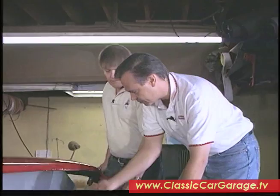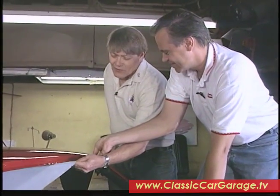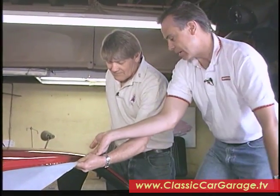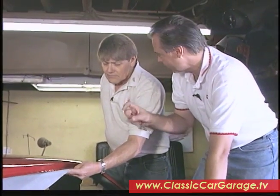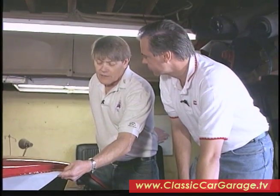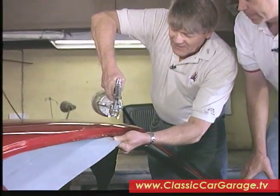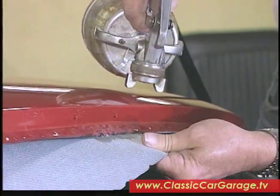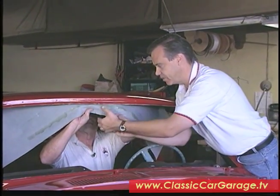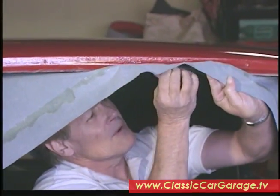Now that we've got our bows installed and the headliner's in the car, the next step is to glue the headliner up here. Your seventh grade shop teacher taught you something very important — when you're doing any gluing, be certain you put glue on both surfaces. You're going to be using a glue gun powered by an air compressor, but the home hobbyist will probably use a spray adhesive that 3M makes — a contact cement available as a spray or brush-on. Weld Wood contact cement works very well. You want to let the glue set up a little bit — wait like five or ten minutes before you start gluing it, otherwise the adhesive doesn't really stick well. Take your headliner and stretch it up tight against the top, starting from the center and gluing and stretching it forward and out as you go along.